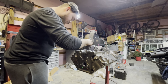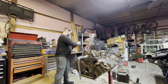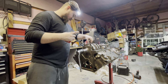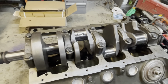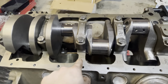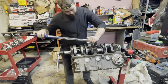That thing's not light. They recommend putting oil on the tips of the bolts, so that's what I'm doing — I got some oil and I'm just putting it on the tips of the bolts. Making a mess on the floor pretty much — slide those in just like that. Get all this done and then we'll start torquing it down. I'm pretty sure this moves smoothly enough — I've never felt one after being rebuilt, but hopefully that's smooth enough. We're going to start with 20 foot-pounds and then go up to 85 or 90. I marked each cap — that one's 1, that one's 4 — so I don't have to keep looking at a piece of paper. We got this set to 20, so let's torque number 1 down.